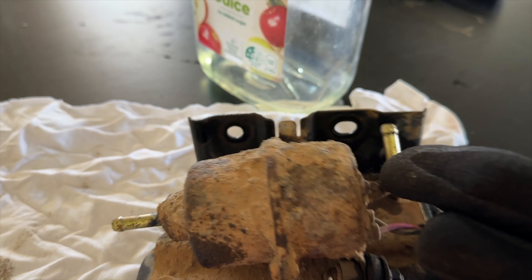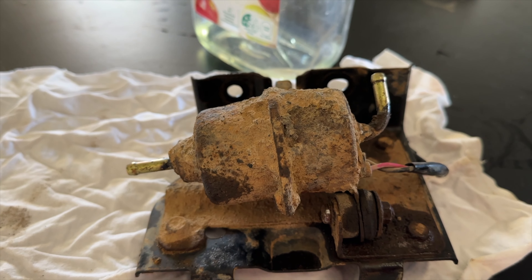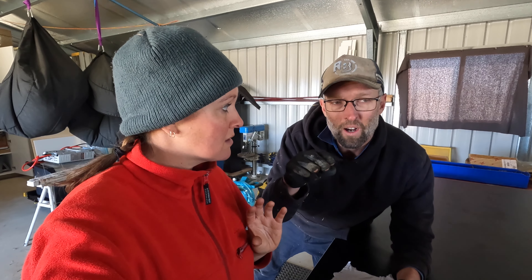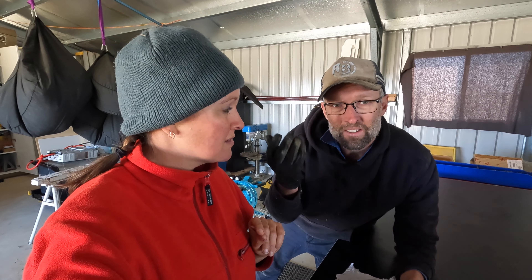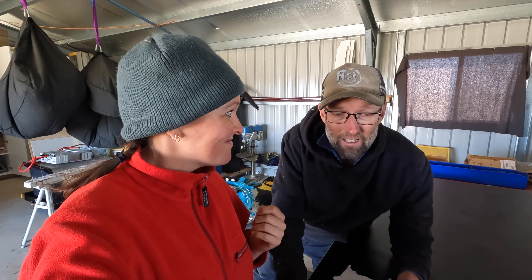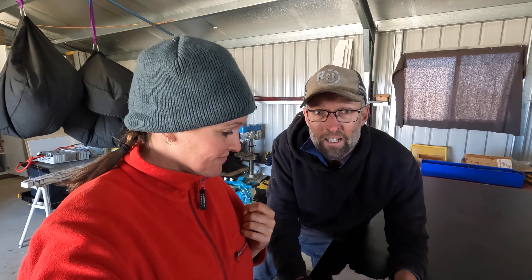Potentially we've just got to replace the pump and run some cleaner through the fuel system to make sure the tanks are all clean and there are no particles left. Our logic is if there is rust in either of the tanks, it's going to be the sub-tank because we don't use it a lot — I always leave fuel in it, so condensation can build up creating moisture, and moisture is rust. We're working on theories at the moment, but potentially there's rust in there.